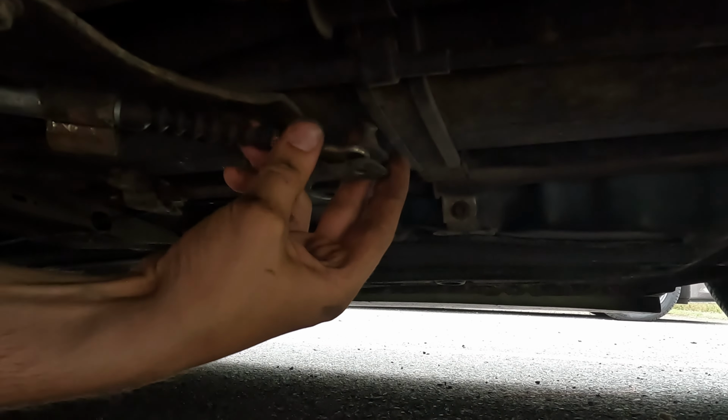Hopefully this works. I think it'll hold on one side, but won't hold on the other. It's better than nothing, right? Yeah. The only reason being is I've changed the pads on one side and I haven't on the other, which you shouldn't do. Why have you done that? Because I'd rather have some brake pads. Long story short, I didn't have enough time to do both sides. And I need to order a caliper wind back tool, but I can't at the moment, I need money.